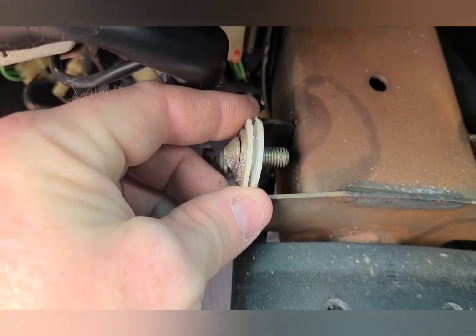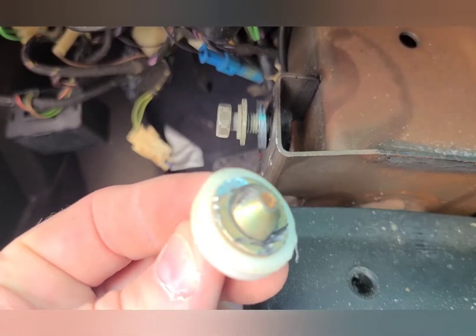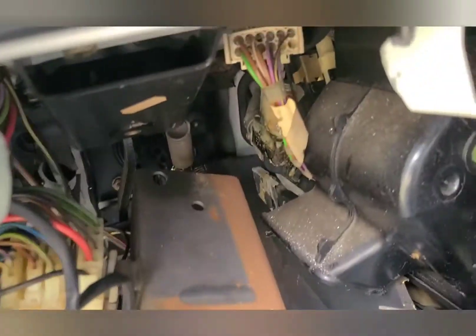This is one of the modifications we're going to do to get this thing adjustable — take these safety bolts out. The easiest way I found is to grind down a flat side on each side so you can get a pair of channel locks to bite it pretty good. Then you're going to notch out these little mount tabs.